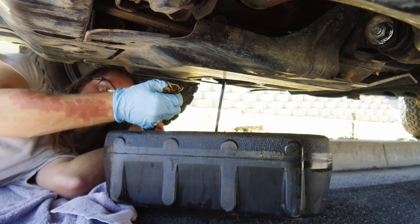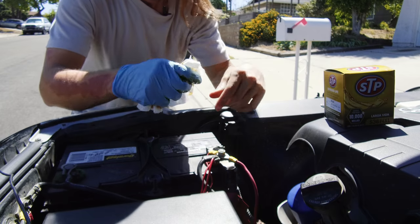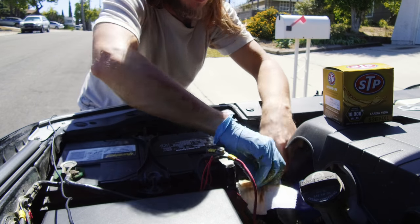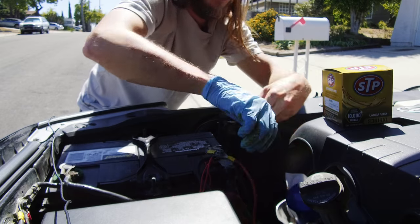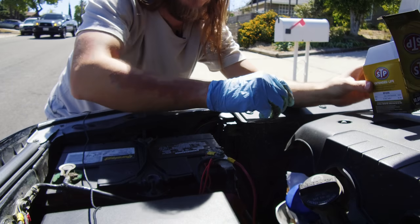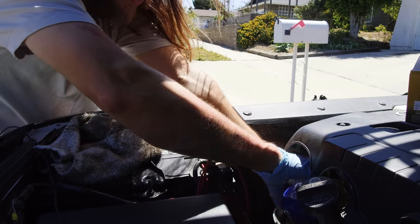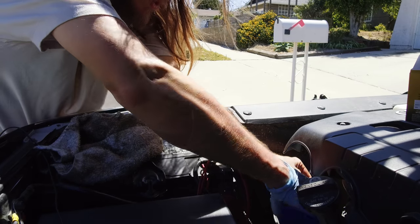This is your oil filter right here. What I like to do — because these things will leak some oil out — I'll stuff a paper towel down to try and help catch some of that when you unscrew it. Have your other one ready; I always put the old one back in the box. And then unscrew this — sometimes they're a little bit tough. It's a good thing we have that paper towel there to help soak up some of that oil.